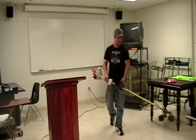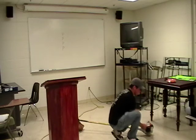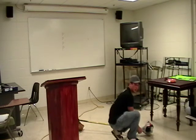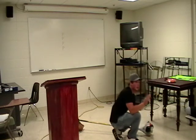Next thing you're gonna wanna do is choke it. On this particular model, you have to set the choke up top high. You pull this down, your safety, and you pull the trigger at the same time. And you're going to want to pull that once or twice until it starts to turn over.